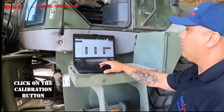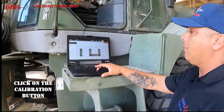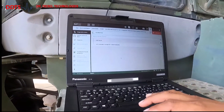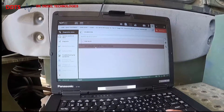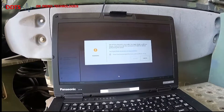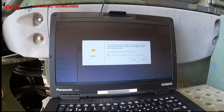We're going to go ahead and perform the calibration. You will go to the calibration tab and click on it. Here you can perform the EGR valve calibration or you can do the VGT calibration. Today we'll be performing the VGT. Click on VGT. Make sure you already have your expert code mode on. If not, ensure that you put in your code when it's requested.